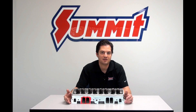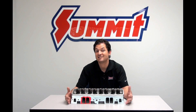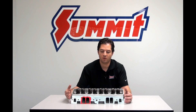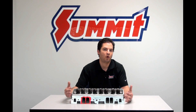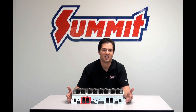For a small block Chevy with a lower compression ratio — somewhere around 9.5 to 1 — and lower cubic inch displacement, somewhere in the 350 range, we probably want to stay with a smaller runner head, something in the 175 to 180cc range, to keep air speed up. If you lack cubic inch displacement as well as compression, the head won't move air efficiently and it'll hurt bottom-end performance greatly. That engine application needs bottom-end performance to get the vehicle moving, because it's probably not going to have a very large camshaft in it either.